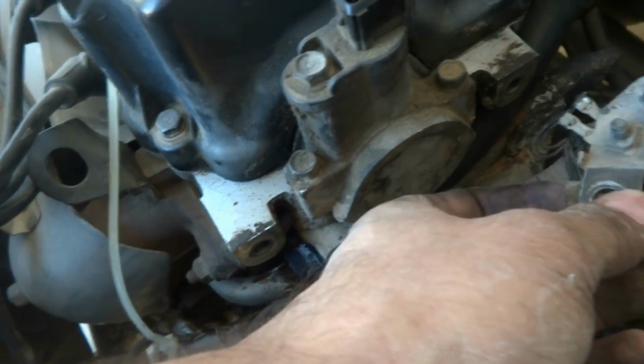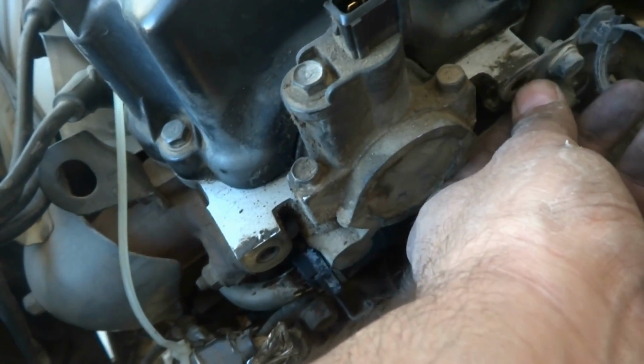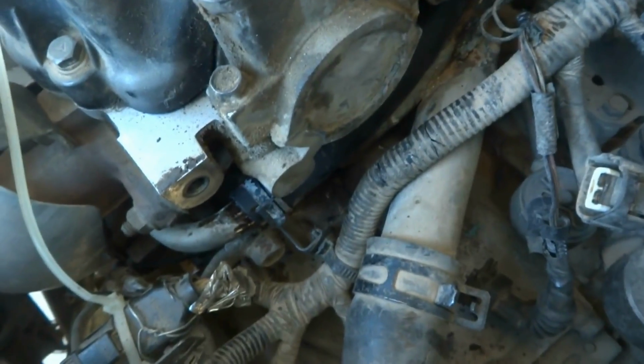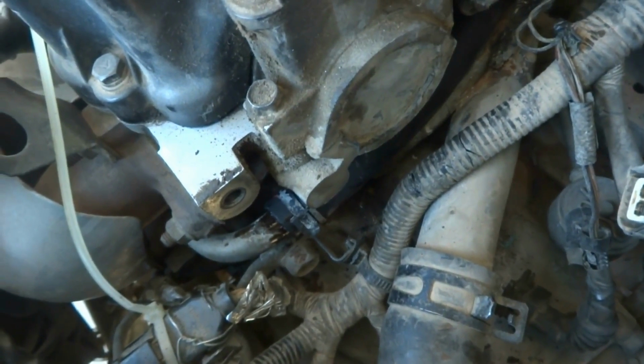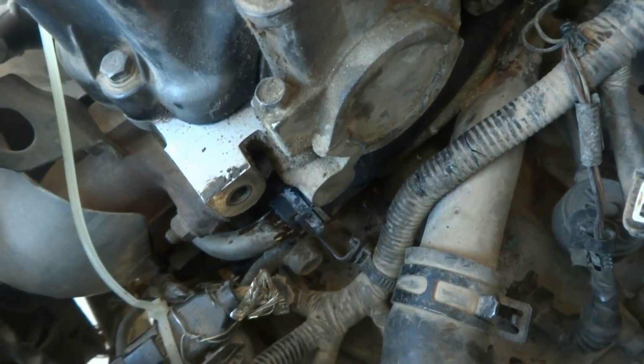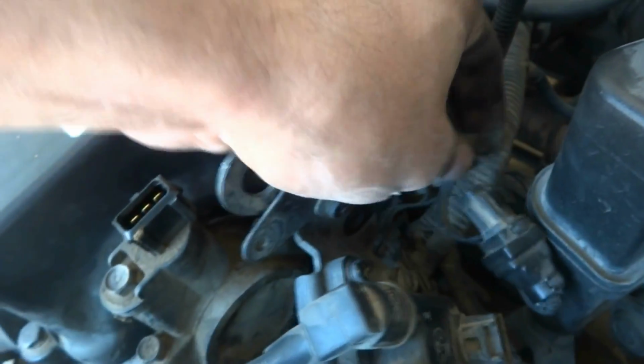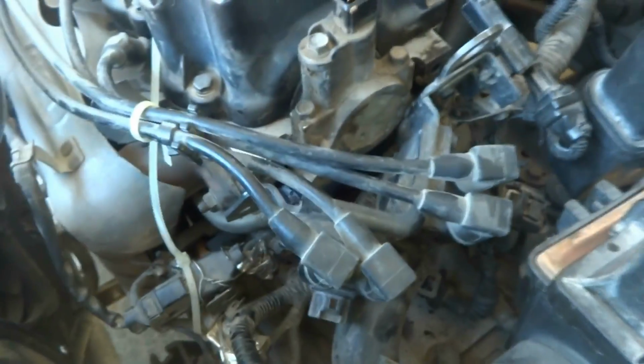You can see there's a ground, and this ground should be connected some way over here. Actually I did not remove this, it was removed by the owner himself, but I see this, and what it seems to be, it should be connected, but first the ignition system should go there, because this I removed, and I remember this should be going some way like this. And of course this ground I will remove it, and then at the end I will fix it.